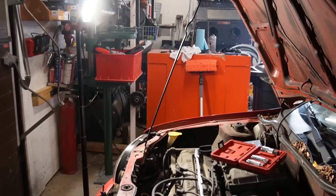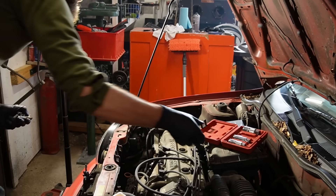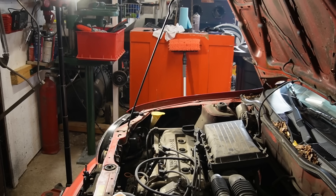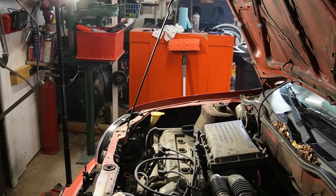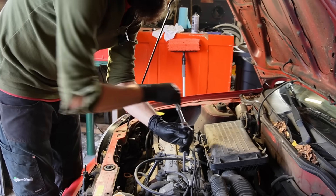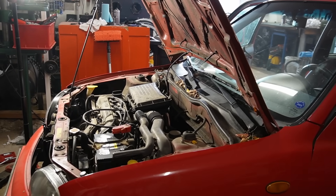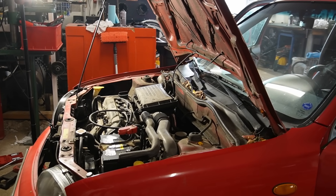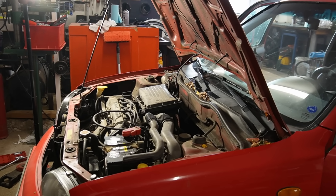Then try to put them back in. But before putting them back in, I'm just gonna crank the engine over without spark plugs in, because I still have a feeling that we've got a flooded engine — and that will clear the cylinders completely of fuel, because remember the pump is not running. So there we go — now it's definitely clean of fuel. I can go ahead and install those spark plugs again, insert the fuel pump fuse, and then crank it. If it starts, I think it has been flooded and the spark plugs have been fouled quite badly and need changing.